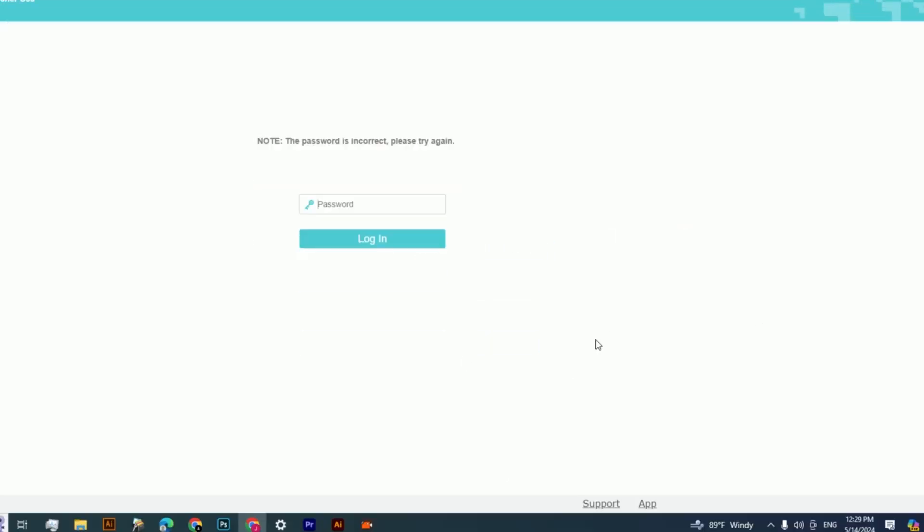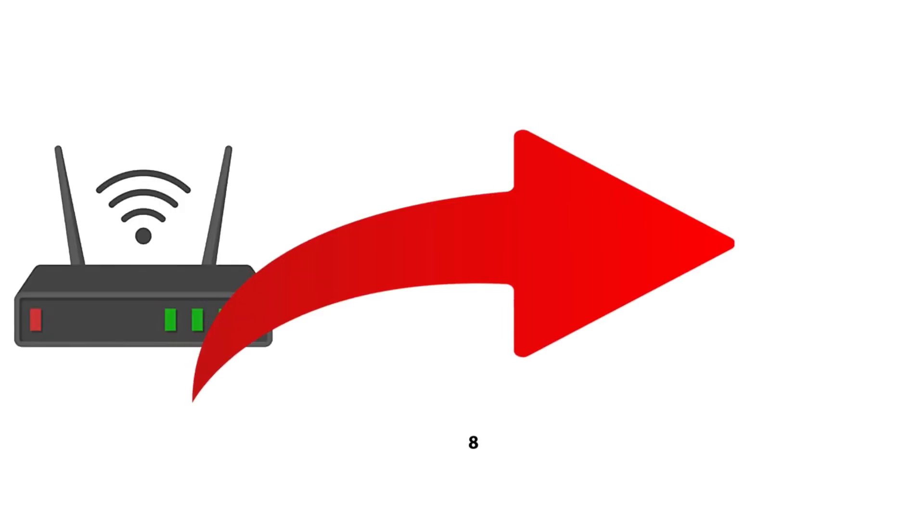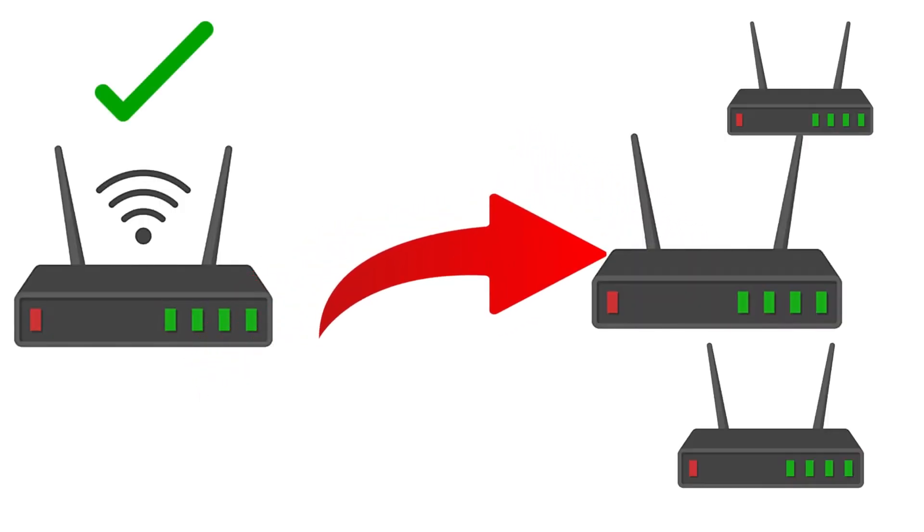After accessing the web interface, go to Wireless, then Wireless Settings. Change the channel to 11 or 8, then save. After this the router needs to restart — reset the router. Primary router settings are done here.